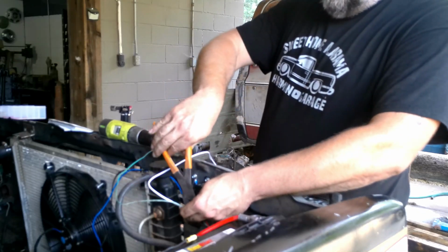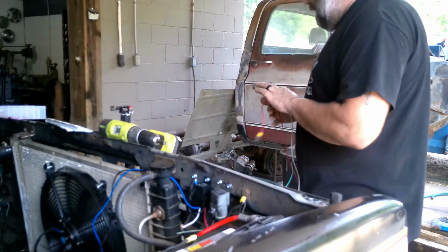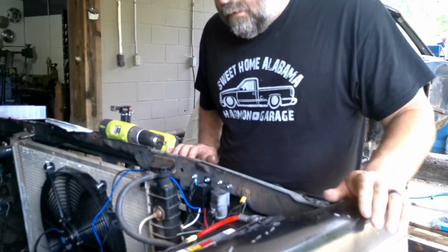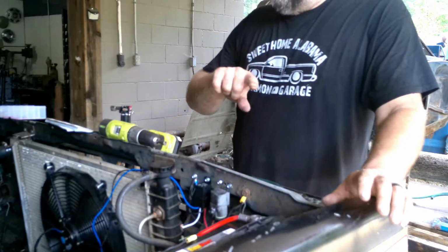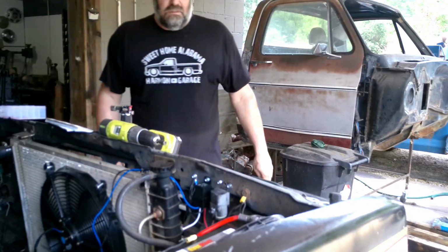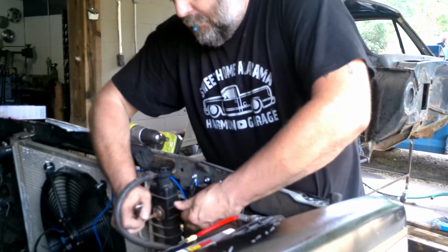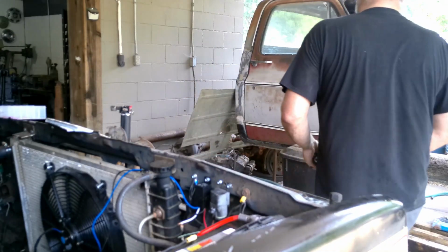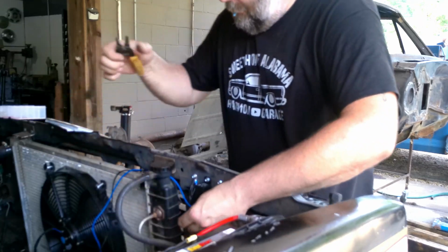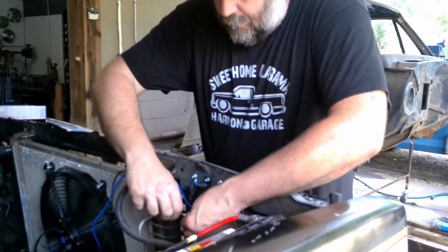So rather than running two wires in, and this may not be right, and I'm sure if it's not, you guys are going to tell me all about it, because it's small current and all it's doing is carrying enough load to turn on a relay, I'm going to wire these two wires together and only run one wire all the way around the truck and into an ignition source. Hopefully whoever just had a heart attack will be okay. Not that big a deal. So we're doing it. We're hooking 2 wires together to run through 1 wire to the same place.